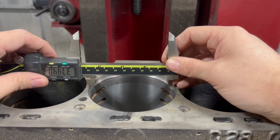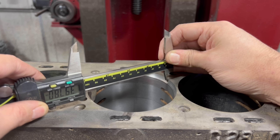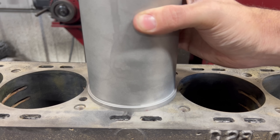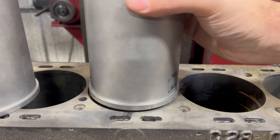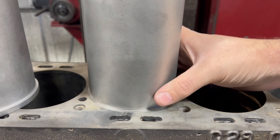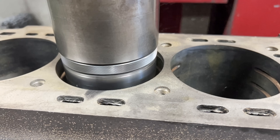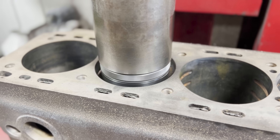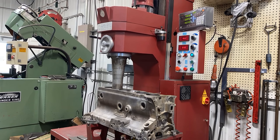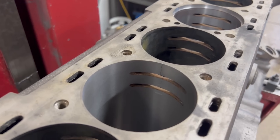With the counterbore cut, a set of calipers shows that our cutter is indeed set to the right diameter. We have one sleeve with a slightly larger flange which seems like it would fit if you pushed a bit, but the rest slide in perfectly with our half thousandths clearance. Now that all of our cutters are set we can go ahead and bore the next two cylinders. We're boring every other cylinder and then installing the three sleeves to those cylinders. We will then come back and cut the bores for the last three cylinders with the overlapping counterbores for the flanges.